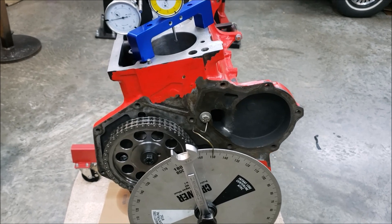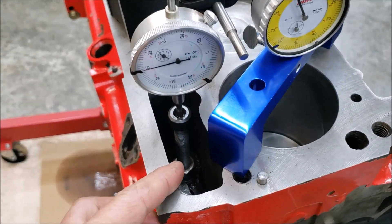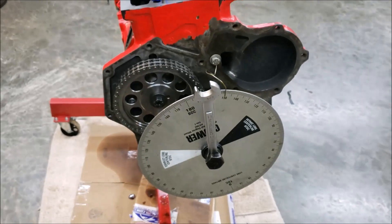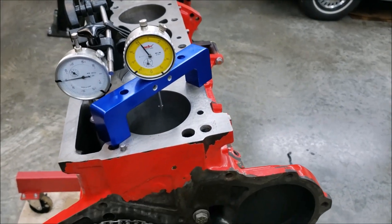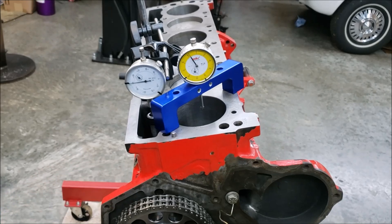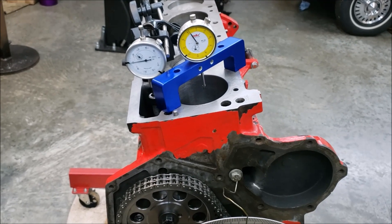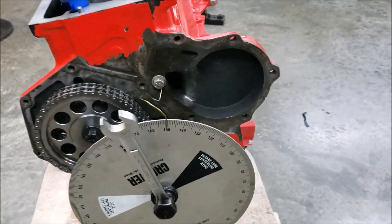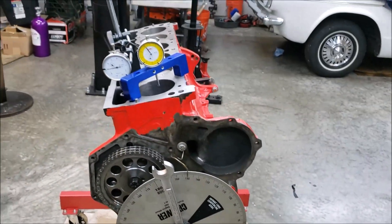I got 106.25. It's a really simple deal. The way I set mine up is I have a little bolt and I put some magnets underneath one of the lifters to hold it straight up. I put this on there, both looking at me, and then I just get the centerline. I do 50 thousandths before and 50 thousandths after on TDC - that's usually 11 degrees on the slant six - that finds me TDC. Then I just go to max lift, mark zero, back it off 100 thou, go forward to 50, write that number down, go to max lift, and 50 after, get that number, add them together, divide by 2, and that's it. One of them was 51, but it's a really simple deal.